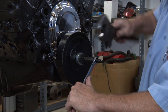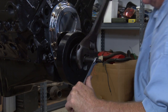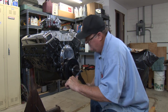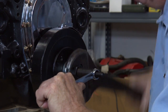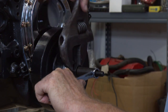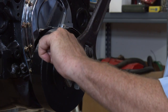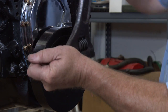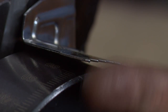You can see it's moving in. Okay, we're almost there. Right there is where it bottoms out — I can tell it's bottomed out against the threads, so we're going to stop right there, back it off. And it's right here, right along the edge of your timing mark.